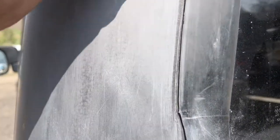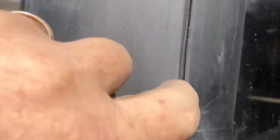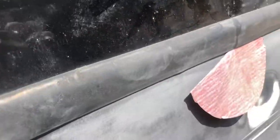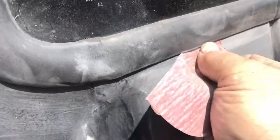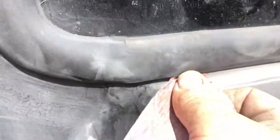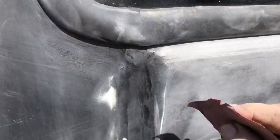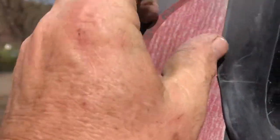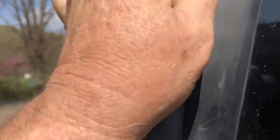Right here I've sanded this, but right down through here there's still a shiny line. That's where you can't get up against that rubber. So here's what we do — pull the rubber back. That's a 320 grit paper, and it's that simple. The rubber actually acts as pressure that holds the sandpaper down against the material or the surface. That's one way of doing it; I'm sure there's a dozen more, but that's how I do it. I'll do that until there's no longer a shiny spot.